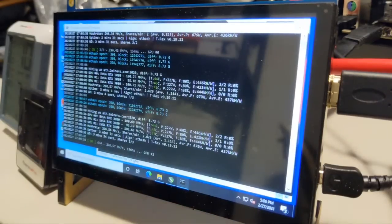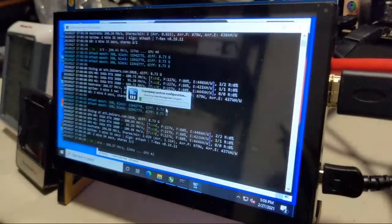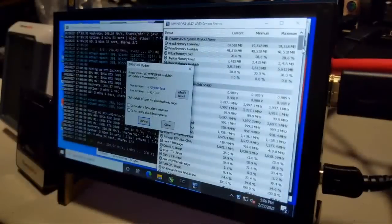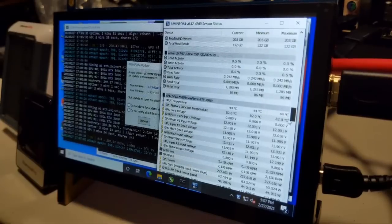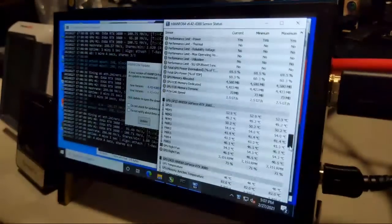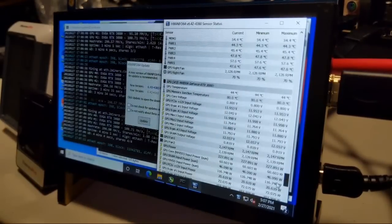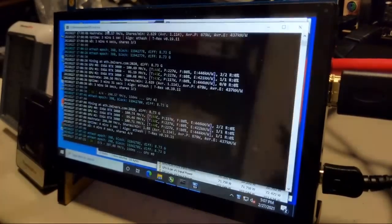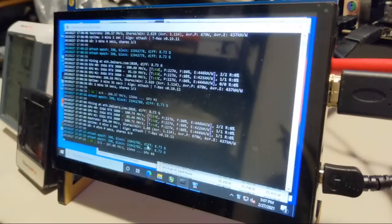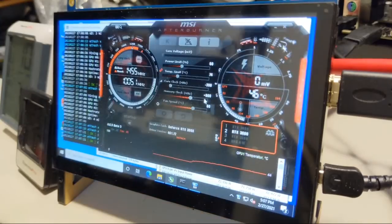Open hardware info? Yes, I will. That is a good idea. Okay, memory junction temperature: GPU1 is 82 degrees Celsius on the memory. Next GPU is 82 degrees Celsius on the memory. The third GPU is 80 degrees Celsius on the memory. Theoretical max is 95 Celsius, so we're good. Okay, we're gonna keep going up here, guys.